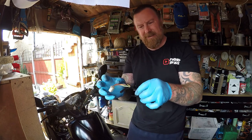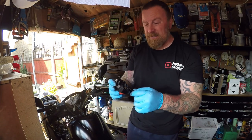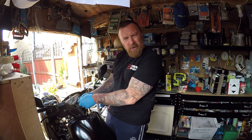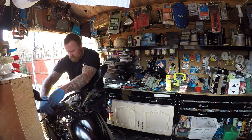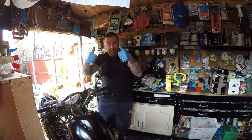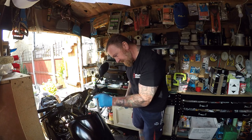Tested, all over and done with. It is the black and — my eyes are bad — the burgundy or blood red wire. Cut that wire. Now this switch does not work. Much better, much safer. Didn't need it. Used the key. Now I've got two Allen bolts to go in there. Just to show you proof in the pudding — I connected it. It's a bit of a bugger to start because you've got all this loose and it's not electric starting for some strange reason. But there you go — happy days. I'm just much more happy knowing that he can't accidentally flick that with his finger, then end up electric starting for ages, kick starting for ages, whinging and moaning, then realising he'd accidentally turned it off with his thumb.